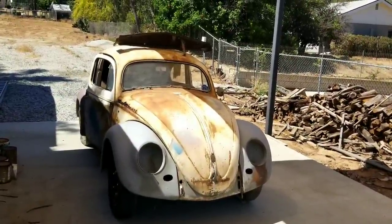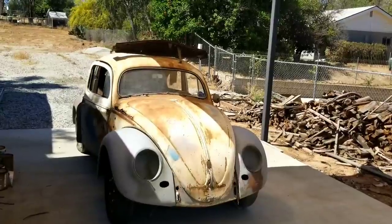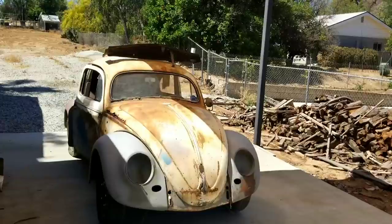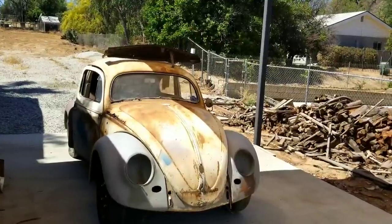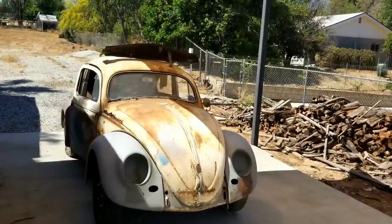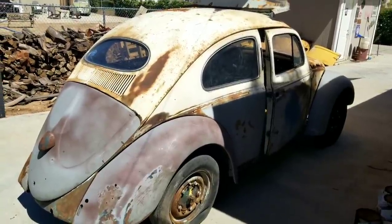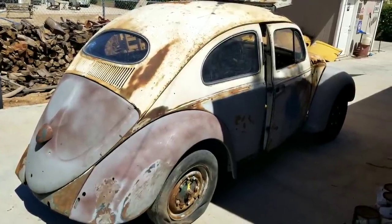On this car I'm not going to put a million hours into it. First of all, it's in pretty good shape — it looks really bad right now, but there really isn't that much metal work to do. The heater channels are in pretty good shape, the body is pretty solid. There's some rust holes but they're so small that I can probably just cut them out, butt weld in pieces, and do a pretty nice job — might even get the TIG welder out to make them really nice and smooth. You can figure out how much time you want to spend and how much time you actually have.